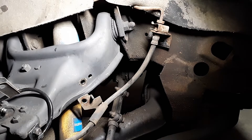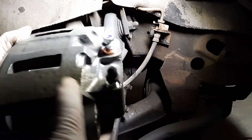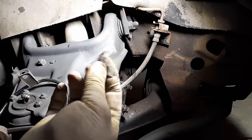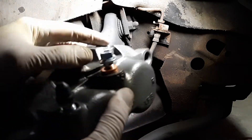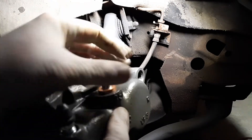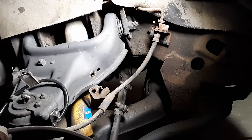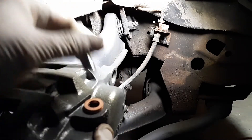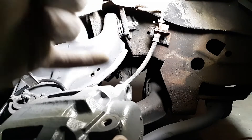The hose is about 20 bucks. The brake hose kit does come with copper washers, but since I'm replacing the brake caliper too, it already has some. Before I hook up the hose to the metal line and fluid starts leaking out, I'm actually going to put the hose onto the caliper first — that way it won't leak and it'll seal better.